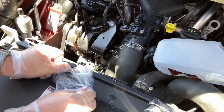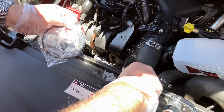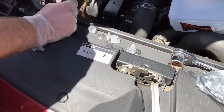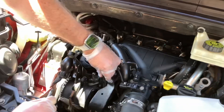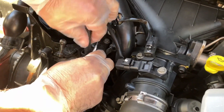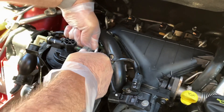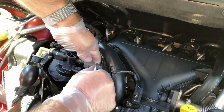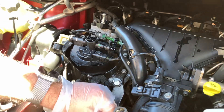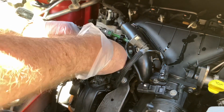I'm just getting these plugs ready because I'll need them to plug up these lines so that the diesel fuel doesn't go everywhere, along with the rubber gasket. The first line here has two things you've got to pinch — the easiest way is to undo this clip, get some leverage on there, then squeeze both of these and it comes off. At that point you want to plug off this line with one of these plugs so it doesn't spray diesel fuel everywhere.